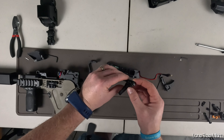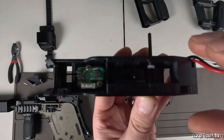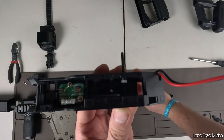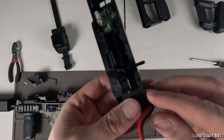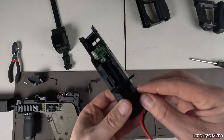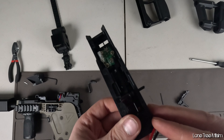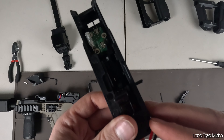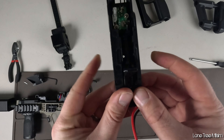Just hold them balanced so that they don't fall out, because we're going to try and put them in — it's a little tricky to get them to stay. I would suggest first getting the spacer and the body pin and setting them up together, as this will help hold everything in place when you go to install the speed trigger. Once you've got it lined up you can then push the body pin through, which will hold the speed trigger in the right spot.